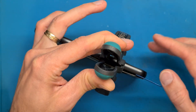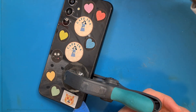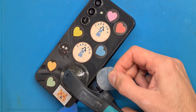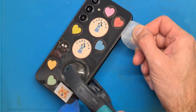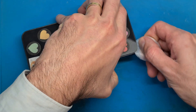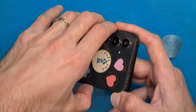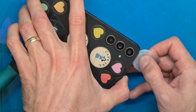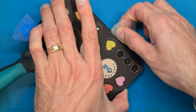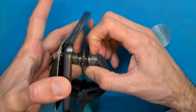We have a very thin edge, and prying an opening tool in between the back glass and the phone's frame is very risky — you could break your back cover. This tool makes everything much easier. It's such a big difference.